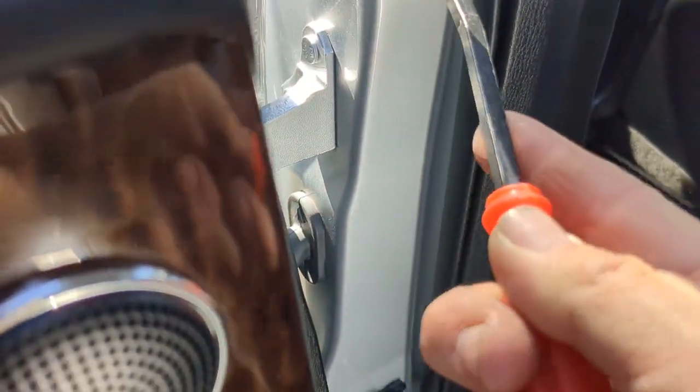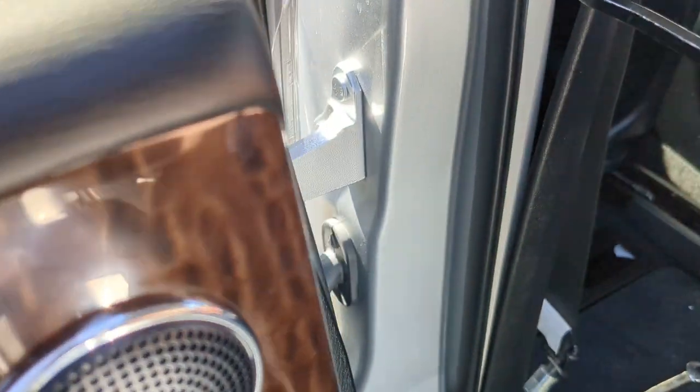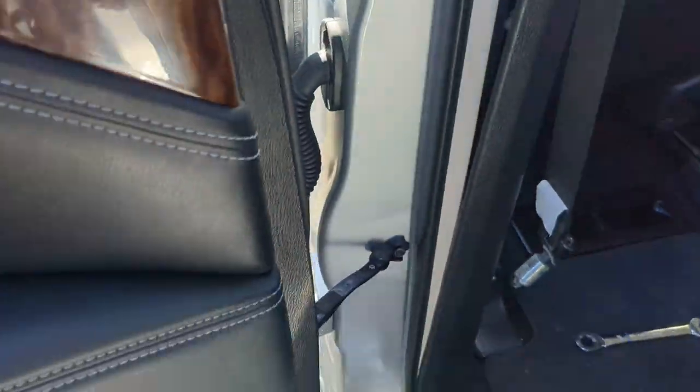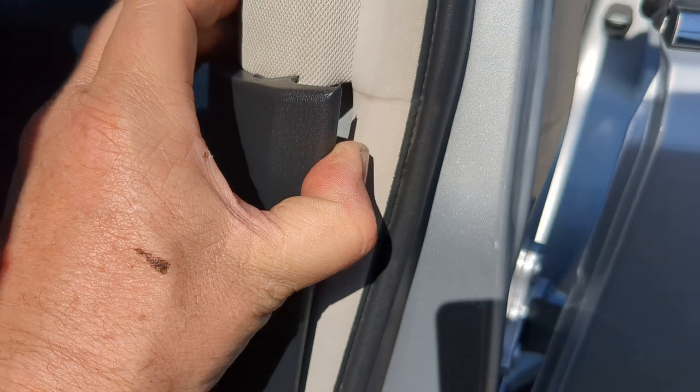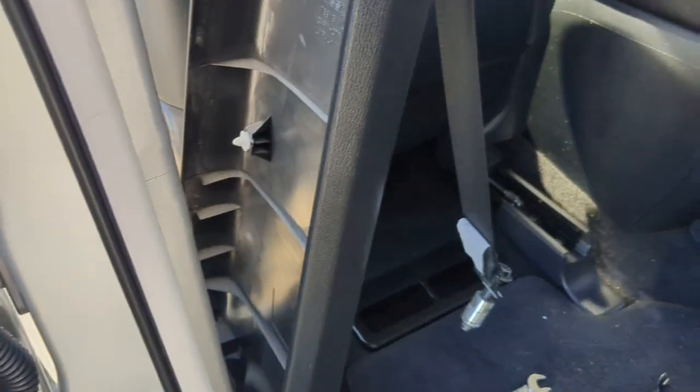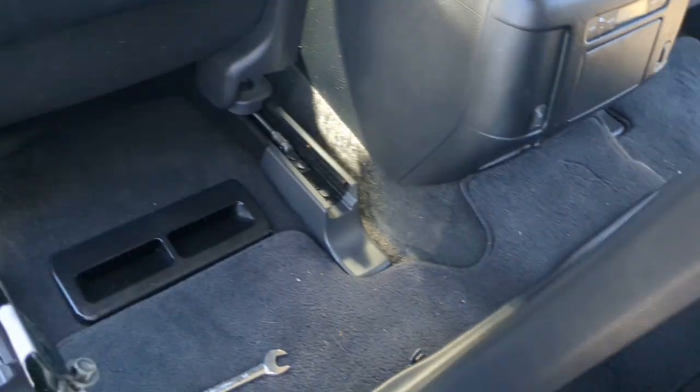Back to the panel popper — go up to the top, get underneath the plastic, and pop it over. This piece sits on top of your weather stripping, so you need to get it off first on both front and back. Work around the door; once it's free enough you can grab it with your hands. You can see the plastic clips that hold it — looks like we lost one down here, we'll fix that before we put it back on. Once unclipped, just lift it up and out of the way.